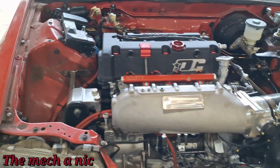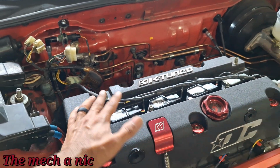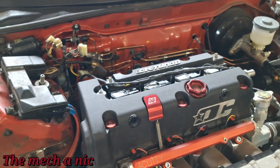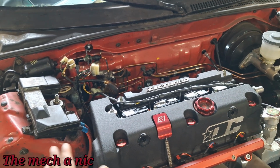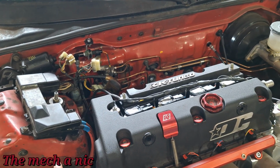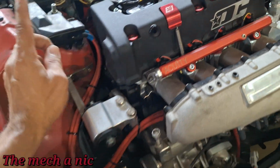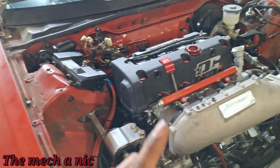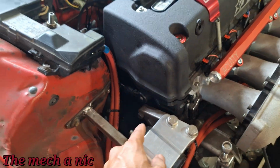So something like this, you want to start easy, right? So yesterday, I actually pulled off the valve cover because it's the easiest thing to inspect. And guys, I did not find anything. Everything looked perfect underneath there. Everything was tight. There wasn't any foreign object inside of there. So I just went ahead and put the valve cover back on. But the second place I want to draw my attention to is behind the timing cover. So that's what I'm going after first.